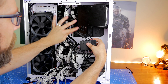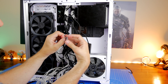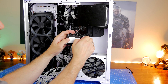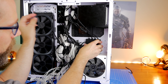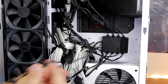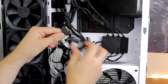There's a sticky back sticker that you can attach to the back of the control box, which allows you to seat it wherever you want at the rear. So I'm just installing it here where there's space. It's a really straightforward setup — everything is plugged in and ready to go. Make sure you have the SATA power connection and the USB connection plugged in — USB into the USB header at the bottom of your motherboard, SATA power into the power supply unit.